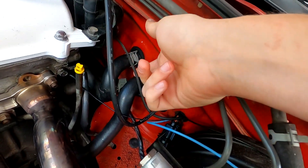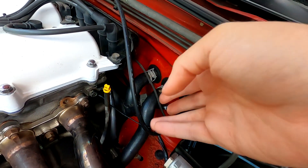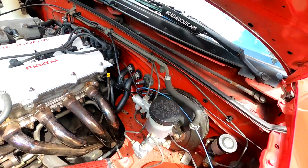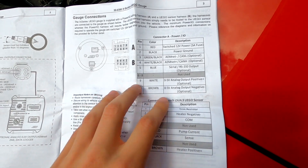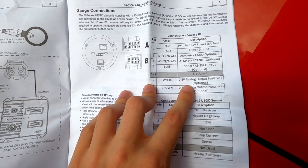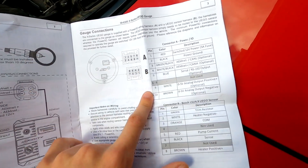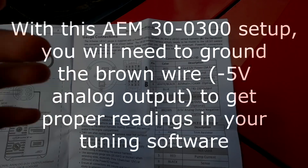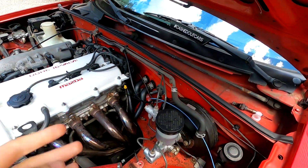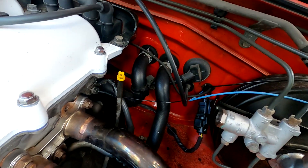The next step is figuring out which wire was the original O2 sensor wire that ran to the ECU. This part's a little scary, but what you need to do is cut that wire and solder in the 5-volt output from your wideband gauge. This 5-volt output is the wideband output of this gauge, and that's what you want to run to your aftermarket ECU if it's capable of using an aftermarket wideband sensor. If it's not, you won't want to use this specific wideband because it does not have a narrowband output — only a wideband output. I went ahead and soldered that in, and then connected the wideband O2 sensor harness that goes straight into the back of the gauge.